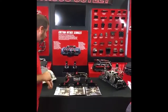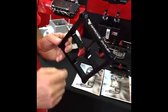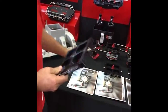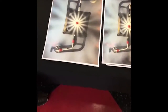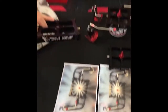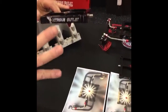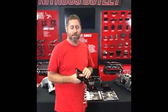So the first thing we did was we invented the Stinger 1. It has a 150-thousandths nitrous channel and 15 nitrous discharges. What's different about this plate is the nitrous sprays outward, and the fuel sprays down at an aggressive angle. So it creates a wall of nitrous right underneath the plate, lets the motor do its natural job, and the vacuum pulls it down into the motor.